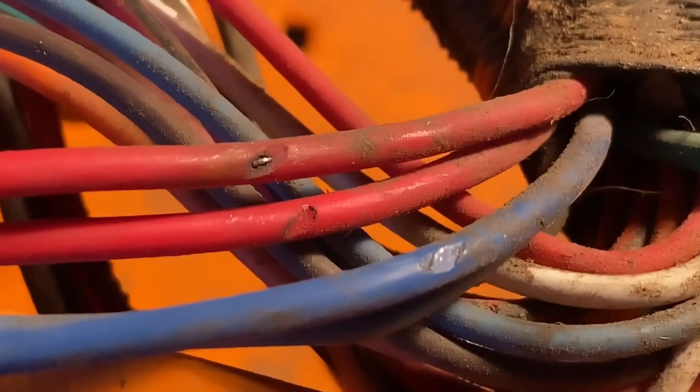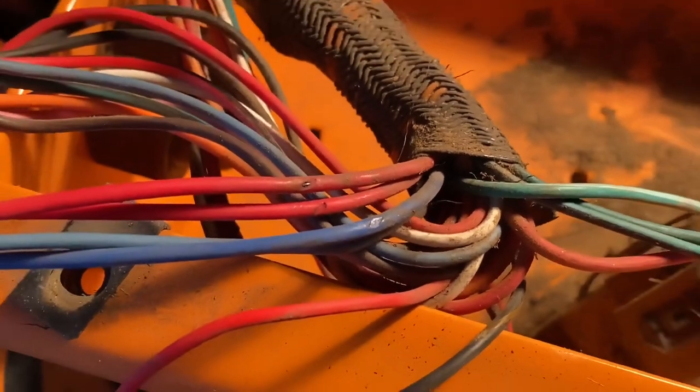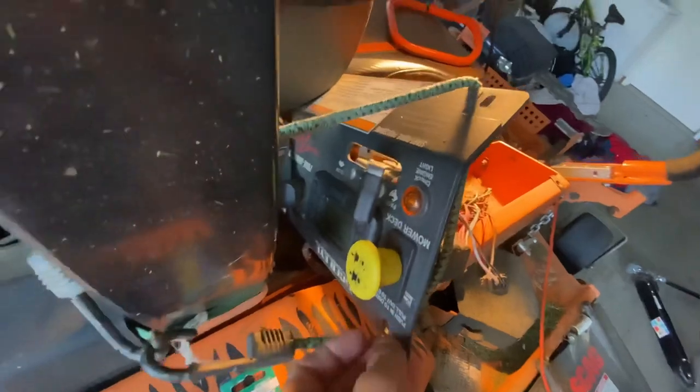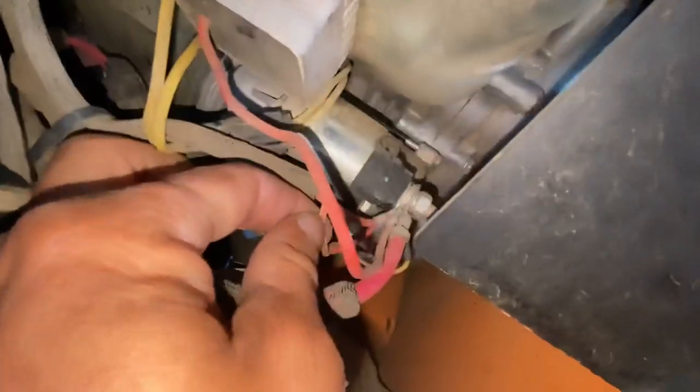You need to check your mowers over — all the wiring harnesses. While we were doing the diagnostics, this area of the Turf Tiger started smoking, which meant there was fire happening. That wire was touching the throttle cable, and the throttle cable all the way back to the engine was over 100 degrees. This is another area he found where wear was happening because of the way it was resting together.